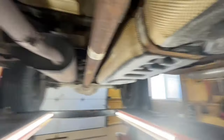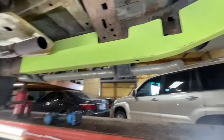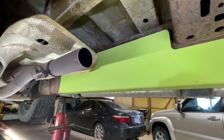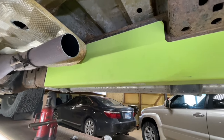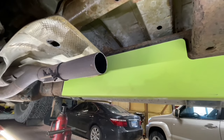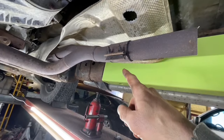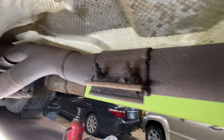I've got to at least drop the gas tank out of this thing. The exhaust I'll probably have to move off too. What I wound up doing is cutting the exhaust — it looked like the clamp was going to be a big fight, and honestly it's going to be easier. I'm going to be in here welding anyway, so it's easier to weld the two pipes back together than to deal with the clamp.